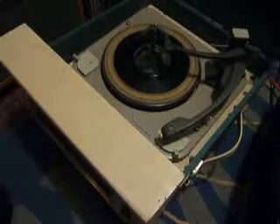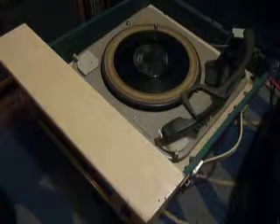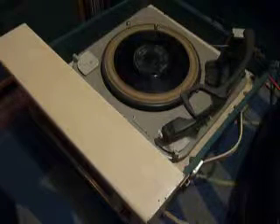Once the arm is on the record and it's playing, carefully lower the stacker arm down so it knows to switch off automatically at the end of the record. If you leave it playing with the stacker bar in the upright position, that will trigger the repeat function, which is for 7-inch records only, and it will replay the same 7-inch record over again until manually switched off.